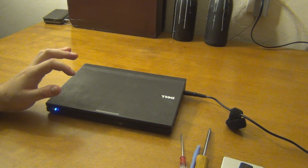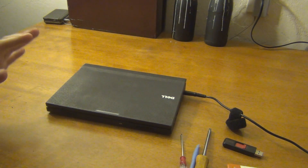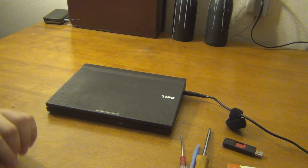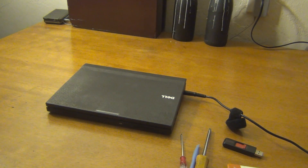I can do a lot of basic things with it, but I wanted to put in an old SSD I have lying around — a 64GB Samsung. I've been paying attention to Task Manager and the CPU is maxed out a lot of the time. But when the CPU is not maxed out, the disk is maxed out because it has a regular SATA laptop hard drive in it. Since we don't have much of a processor, getting information to the CPU as quickly and efficiently as possible is important, so it's not wasting cycles waiting for the disk.